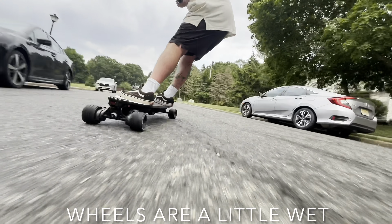As for the wheels, the new B1 Manda is utilizing 100mm Cloud Wheel Hydro wheels — 64mm in width and 76A durometer. The exterior of the wheel has anti-skid rubber which redirects water, preventing you from breaking traction in wet conditions. Not only does that rubber on the exterior help you ride in the rain, but the core is all polyurethane, which helps with durability and range. The water-shedding channels are cut out in a directional tread pattern to ensure rubber stays in contact with the ground in wet conditions.